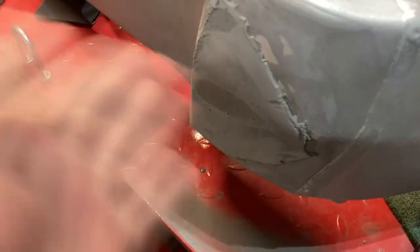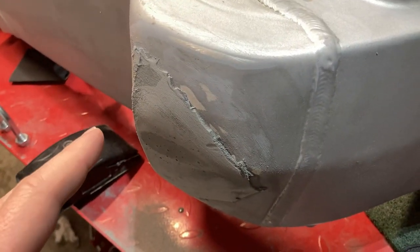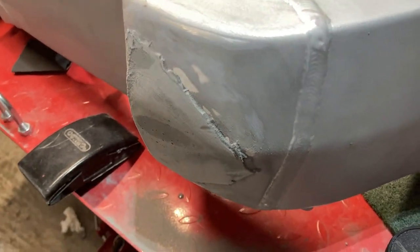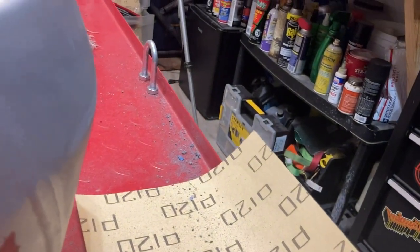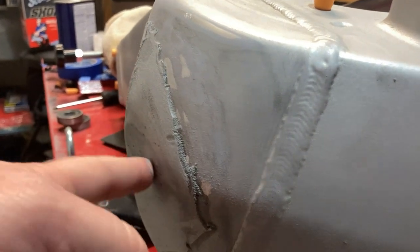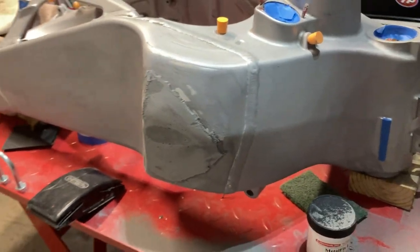Of course, I'm not sponsored — that's just what I call it; there are other brands. When I get this close to being where it needs to be, I'm going to use some body filler to get it to that last bit, with the potential of getting some of that self-setting metal epoxy that you see at all the stores — comes in a tube. If I need to build this area out to fully match the profile on this side, you can see where that profile has a nice clean ridge, and this needs to match that as close as possible. It has potential to get there — there may just be a little bit in this area that I need to add to. If you have working knowledge of what I'm doing here and you're a pro or you've done this before, let me know in the comments.